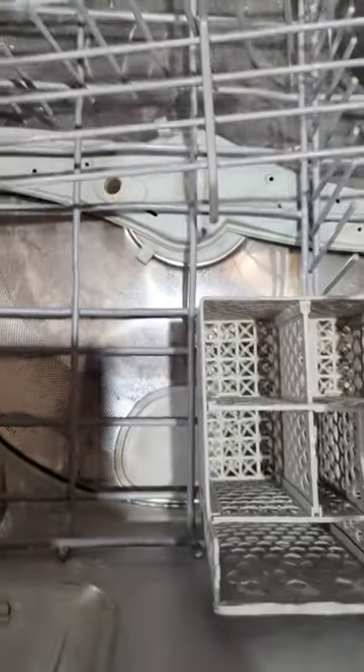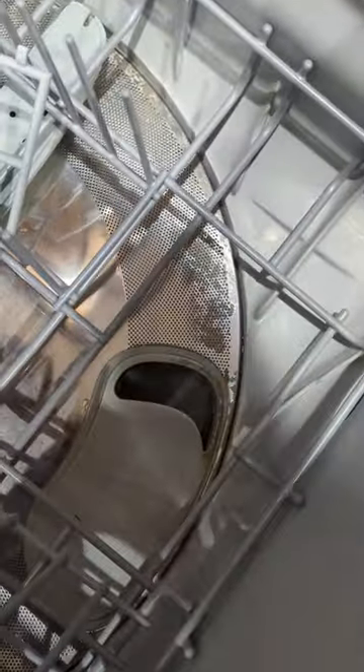This video is for people that own a double drawer Fisher Paykel dishwasher. A couple things I've tackled this weekend — all those holes are pretty clear now. They were not earlier this week when my dishwasher went into a mode, and this one seemed to be the culprit of water in the bottom of the pan causing the float switch to send the dishwasher into idiot mode.